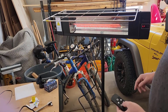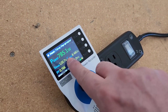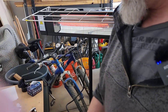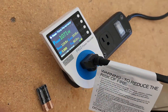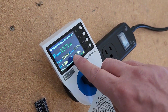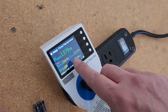Here we are — level one, which should be about 700 watts, and we can see we're at 785. That's good. If I bump it up to level two, which should be about 1,000 watts — yeah, about 1,070, that's good. And if I bump it to three, the big guy, should be about 1,500 — we're a little under that, so 1,380. I'm sure it's going to fluctuate back and forth as it heats up, but pretty close to 1,500 watts.